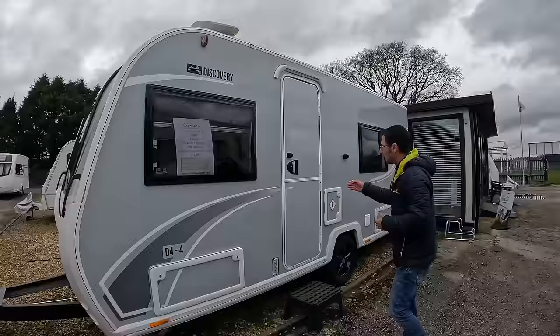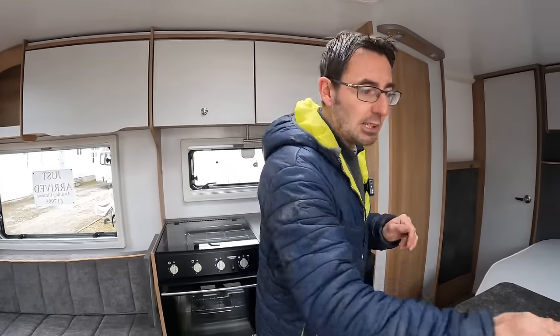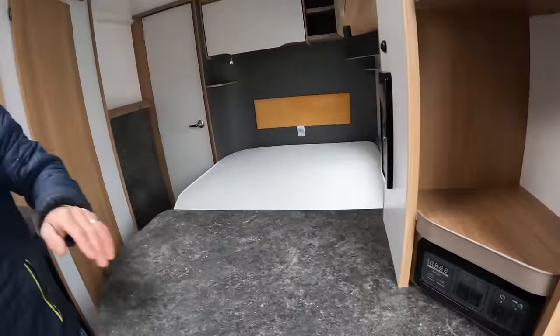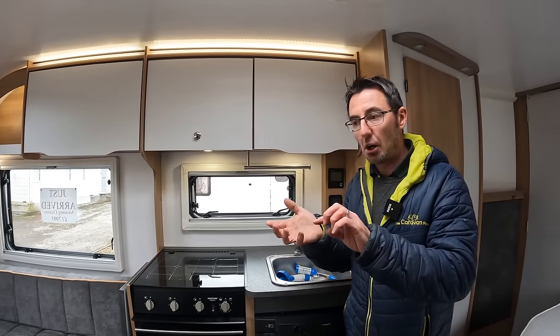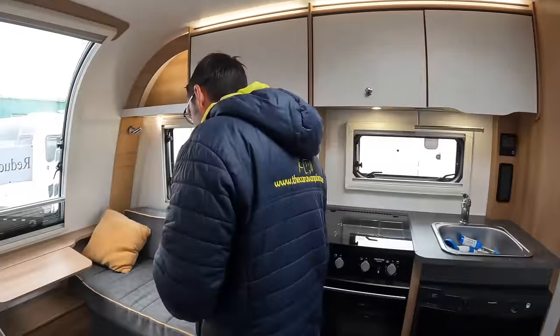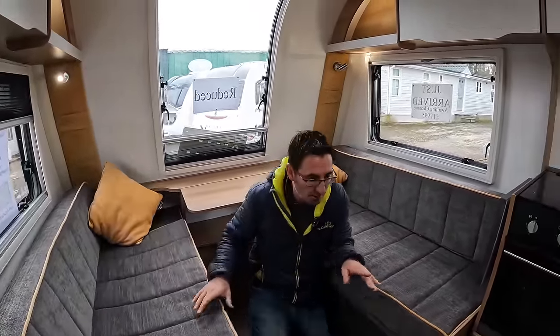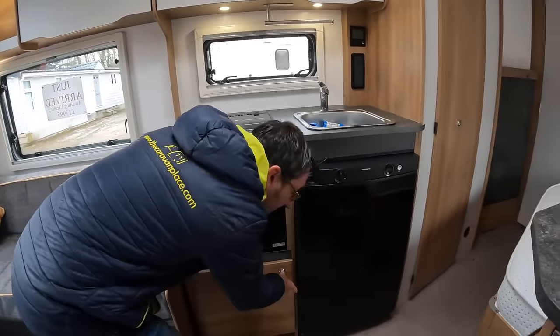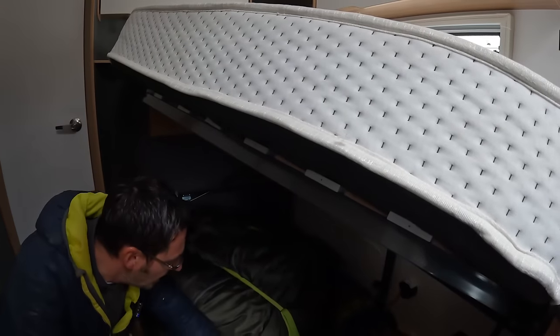After your first day or so, our battery power seems to have run down — the lights are starting to go dim. There are two possibilities: either we've got a bad battery, or we haven't got the charger in the on position. There are lots of different setups, but normally you'll have an isolator to turn your charger system on and off. It helps to do a recce of your own caravan so you know where everything is.